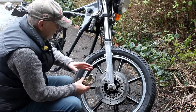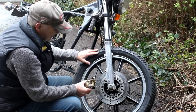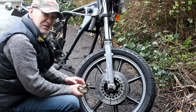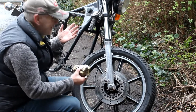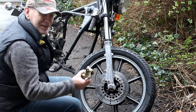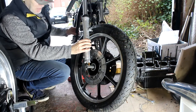It means I've got to strip down the front end, take the wheel off, and basically take the whole front end to go and see Jeff so he can make up the appropriate spacer rings for the discs. It's starting to rain now. To do that job I've got to be out here in the rain stripping down the front end, at which point it's no longer a roller - so I might as well keep going and strip down the whole bike and store it away as best I can.